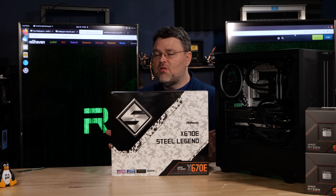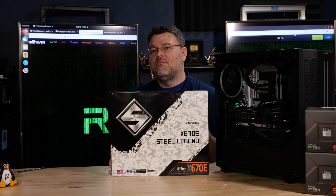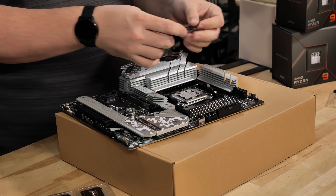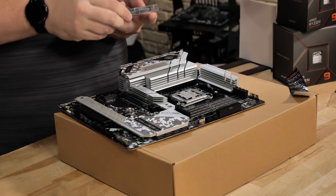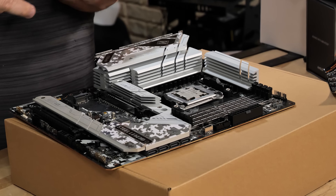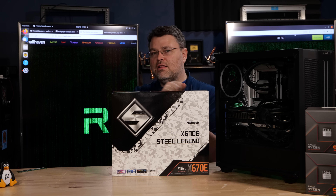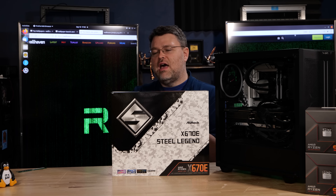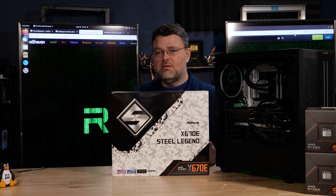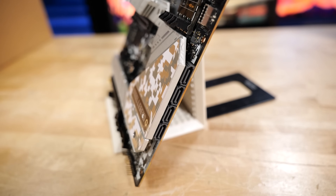This motherboard, not being the most expensive in ASRock's X670 lineup, still has Nahimic audio, Polychrome RGB, and everything you'd expect from an ASRock solution. I also really like that the memory slots are not only reinforced but also surface mount soldered. With through-hole soldering the wire goes through the circuit board giving mechanical strength, but surface mount — wave soldered — DIMMs have only a thin layer of copper holding them to the PCB, so they're not as mechanically strong. ASRock has added physical reinforcement features to help with that. The board also features four SATA 3 ports so you can run a mix of M.2 and SATA.